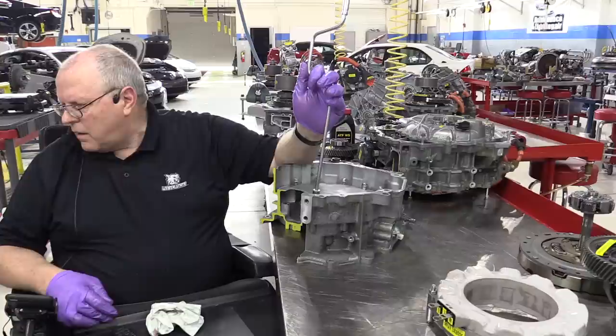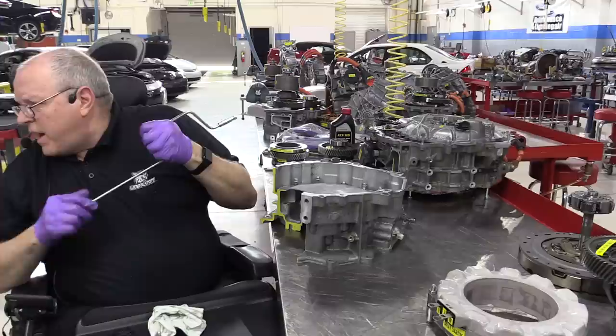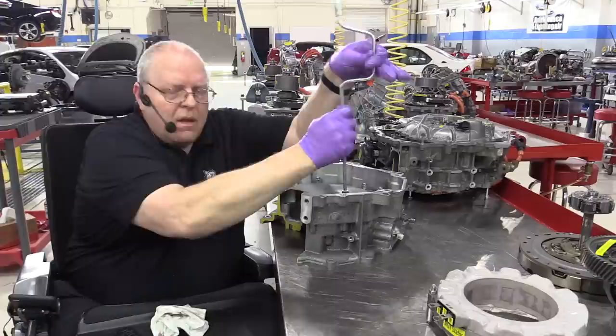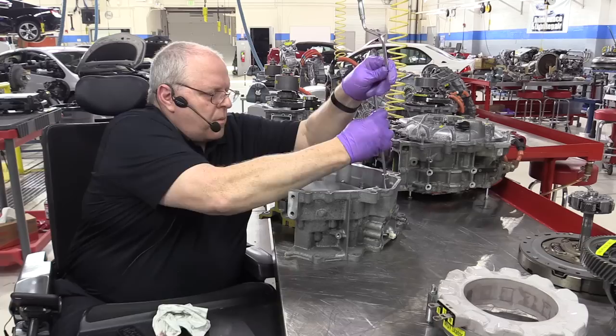By the way, this transaxle is about 9 millimeters narrower than the first and second generation transaxles, and it is also weighing in at 202.8 pounds versus 236 pounds on the previous generation transaxle. So we lost 34 pounds approximately of weight going to this smaller, more efficient transaxle. But we went up in torque and horsepower on this transaxle, and better efficiency, fuel economy, and so on.